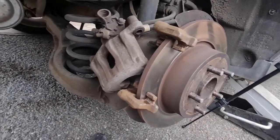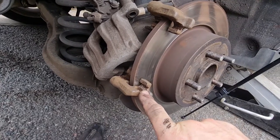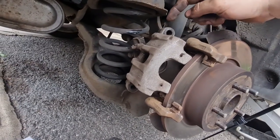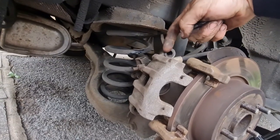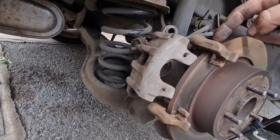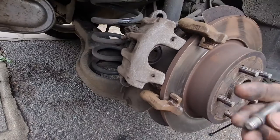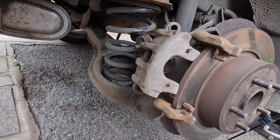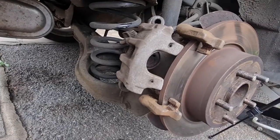As you saw from that time-lapse, it's all cleaned up. I've gone over the whole caliper — didn't really need to but gave it a quick clean-up, looks a bit nicer. I've cleaned up these channels and put some copper grease in there on all four of them. This is actually a really easy brake pad change on this car. There are two chrome bolts which act as sliders, going through the back of these rubber grommets and into the carrier. You leave the carrier on there for pads only — you only need to take the carrier off if you're doing discs as well. I'm going to get the new pads on now, use a little bit of three-in-one oil rather than grease in these rubbers so it doesn't get gunked up.